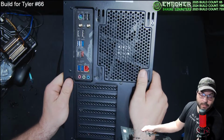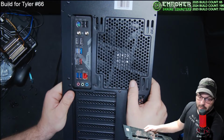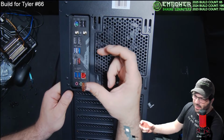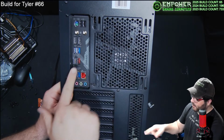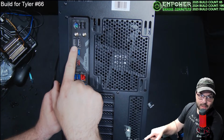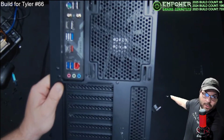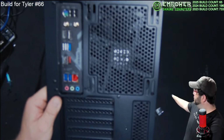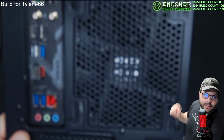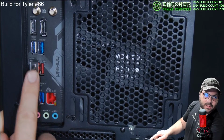If you look on the back of your motherboard, if it doesn't have support for the 9000 series CPU, Alt, you can download the new BIOS to a USB drive, follow the instructions to set up your USB drive, and plug it into your BIOS USB port, which is usually a white one. On this motherboard, it's white. And then there's a little teeny tiny button, we could zoom in here for you. Maybe it doesn't want to zoom in. It's trying to zoom back out. Hold on. Okay. There's a little teeny tiny button here that says Q-Flash.